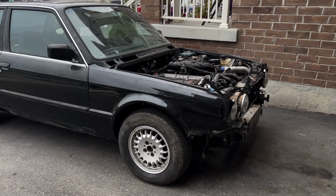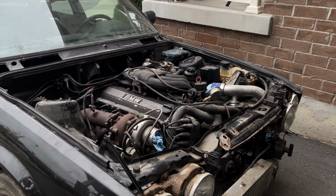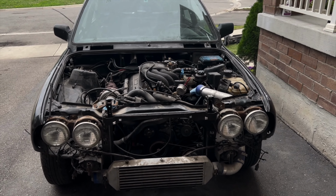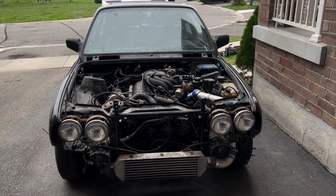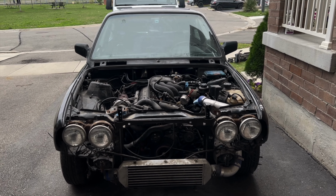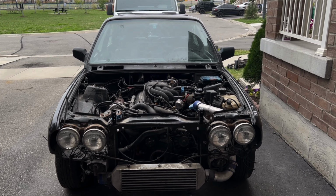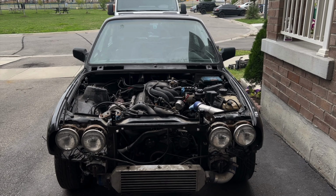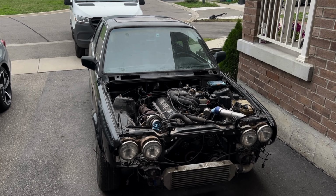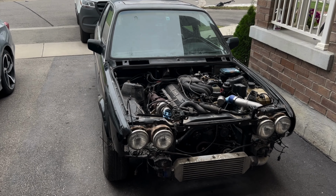I still need to jack it up to remove all the wheels and see the suspension and everything. One thing I do know, I was taking it out of the trailer and the tie rod on the driver's side just snapped. So I have to replace that. I'm gonna buy the kit to replace the whole suspension and control arms for the front and rear both. And I need to change the suspension slowly and replace most of the parts that move. So yeah, overall the car doesn't look that bad. Should be pretty easy to work on.